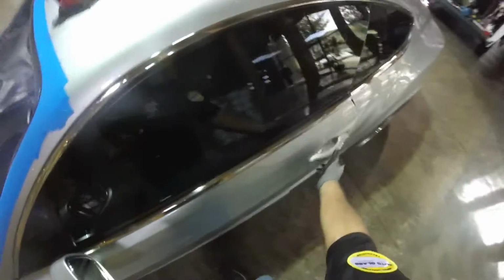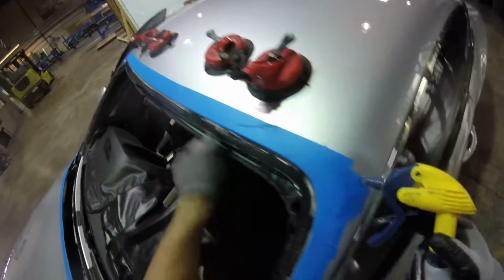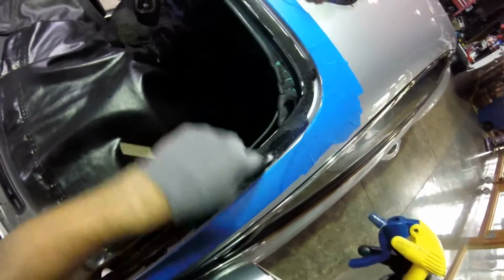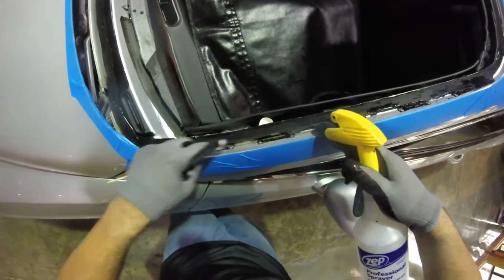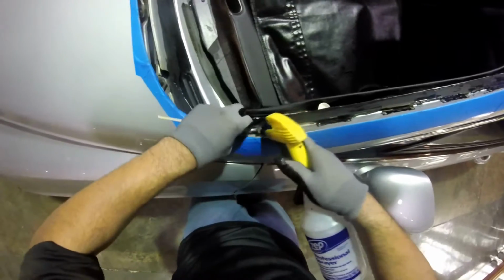You see, the door fits perfectly fine, but there is still a little gap in some areas, and this part in the back. So it's going to clean this area. It's not much in this area, so it's very close. In this case, they block the area for the glue, where the drain water goes. This block is good. So you see here, it's running beside the moldings, but when the moldings are in, it's more difficult for the water to just go away. So they put the glue on the wrong thing right here.